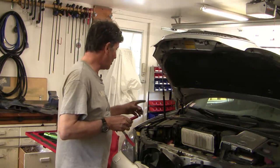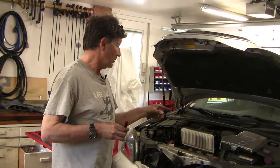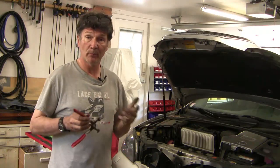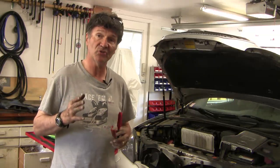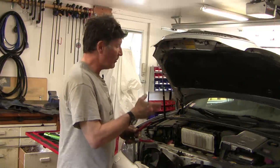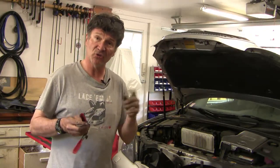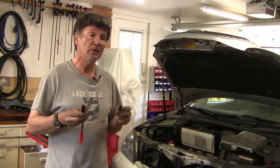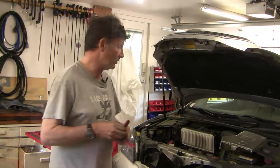I'm going to put the air box on, then add some coolant, run the engine with the cap off, and we're going to burp the engine. This is honestly the most critical part of it, because if you mess this up you could kill your engine. You want to make sure that all of the air bubbles are clear from the system so the engine doesn't overheat. You don't want a water pump that's not able to circulate because it's trying to pump air, causing a localized overheat and damaging the engine. This is really critical.